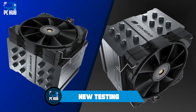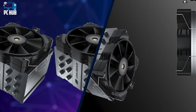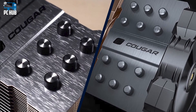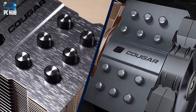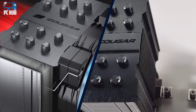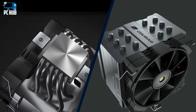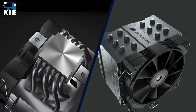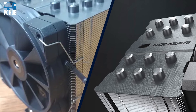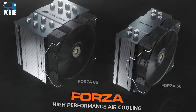I'll be testing the Cougar Forza 85 with Intel's Core i9-12900K. Due to the increased thermal density of Intel's Intel 7 manufacturing process, as well as changes to core and component layouts, Alder Lake CPUs are more difficult to cool than previous-generation CPUs in the most heat-intensive workloads. This means that coolers that kept previous-generation products like the i9-10900K cool sometimes struggled to keep Intel's i9-12900K under TJ Max — the top temperature before the CPU starts to throttle. Many coolers I've tested aren't able to keep the i9-12900K under TJ Max when power limits are removed in workloads like Cinebench and OCCT.